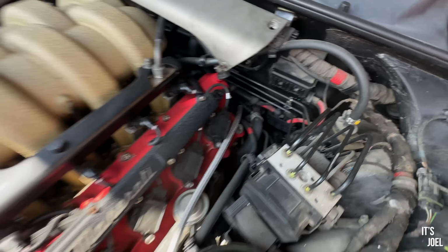So in short, can one recharge, regas their AC systems at home? Well, if that one is me, who likes to buy very cheap, once expensive, exotic cars 20 years down the line, then the answer is no. But for you, with a car that's probably working and may just need a regas, it's a fairly simple, easy system. You find exactly where the port is online with your number plate or your car make and model, and then immediately this will plug in and tell you what the pressure is. But it's clearly something's going wrong with this Maserati, as it's reading 88.